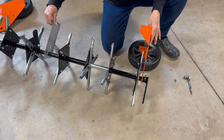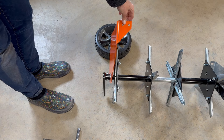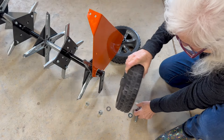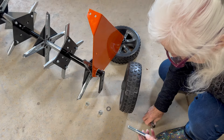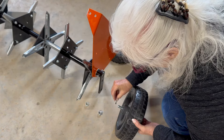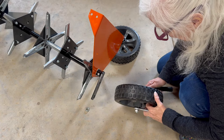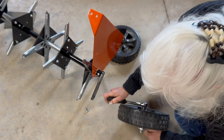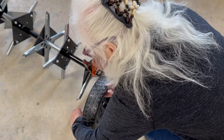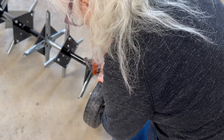This should be at the same angle as that, and then we'll do the other side. There seems to be a little bit of play in these, but hopefully that's normal. Step eight: I laid these out in the order asked for in the book. The fat part of the tire goes inside the big bolt. Washer P goes through there and then the other washer P, and this nut — it's the same on both sides — goes on there with the half-inch. It says not too tight because you want it to spin freely. Tighter, just enough so you can spin it but not a lot.